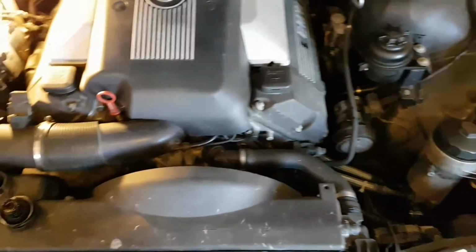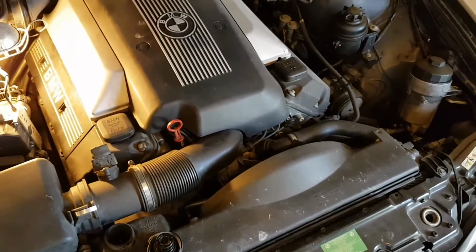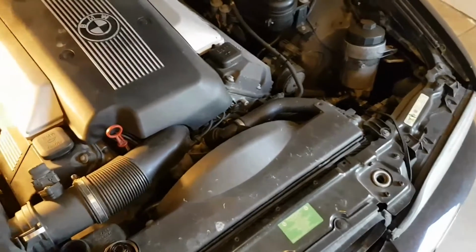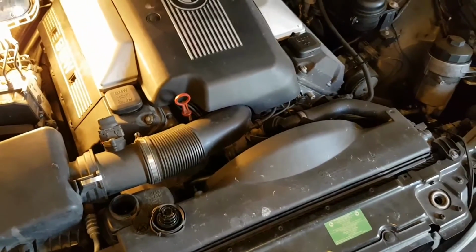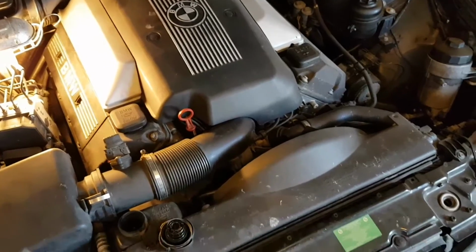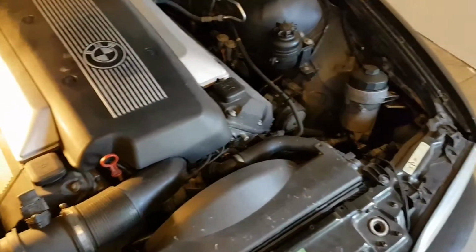It's going to be full duty for the winter, and once the winter's done, maybe that'll get treated to a couple of those check valves. I think they're $30 a piece or so, just probably 20 minutes each. They're not hard to install. Just pull out the Vanos solenoids, which is just pop, there they go, and there's a special tool that just threads into them, and they yank them out, put them back in, and then we'll see if that doesn't keep the oil in the container a little longer.